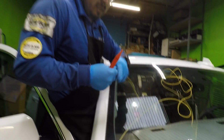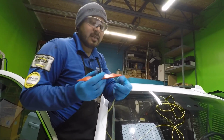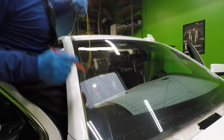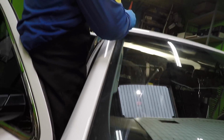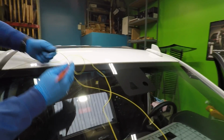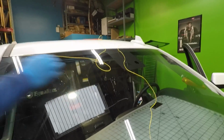So for everybody that maybe you want to save the molding or it's hard to put the fiber line in, you would put this in through the back of the stick like this, and this would help you put the fiber line under the molding. In this case, I'm not going to worry about it, but as you can see, it's helping me guide the fiber line. On the corners, it's very important to tuck it in underneath, okay? I clip my little bone there.